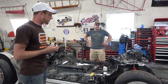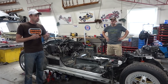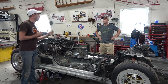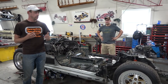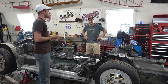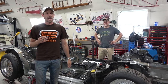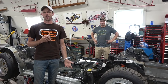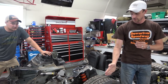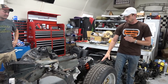The difficulty is the Porsche Boxster is by no means that sort of a low rider. The first thing that had to happen is we needed coilover shocks of a configuration that allowed us to get very low. We had to put them on in not necessarily the appropriate way because we're going even lower. When you go really, really low, you get into a realm of stance life, and that's stupid because it makes cars handle like garbage. When you get a car super low, you get into massive amounts of negative camber because you're pushing the suspension into extreme positions.